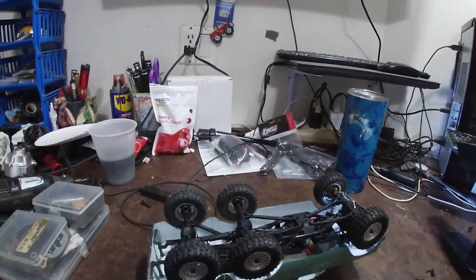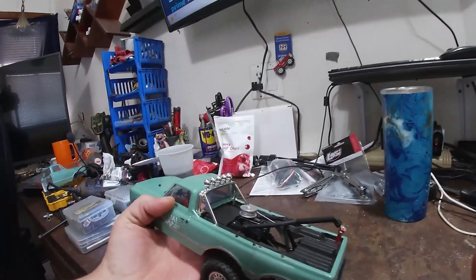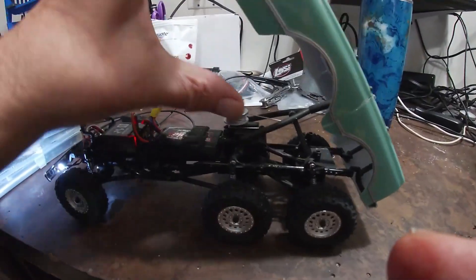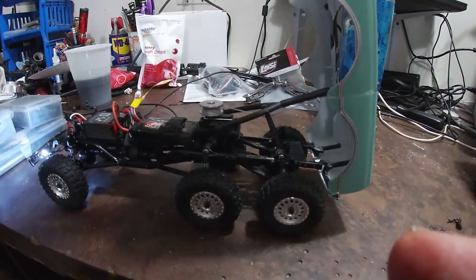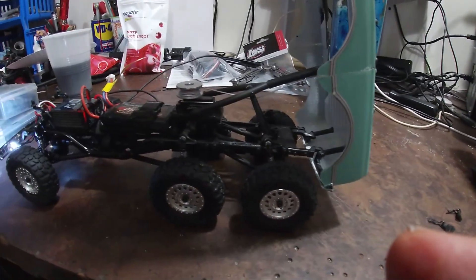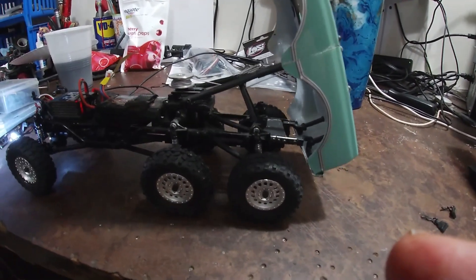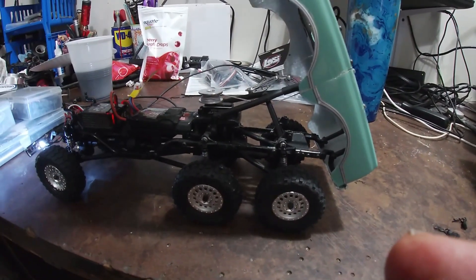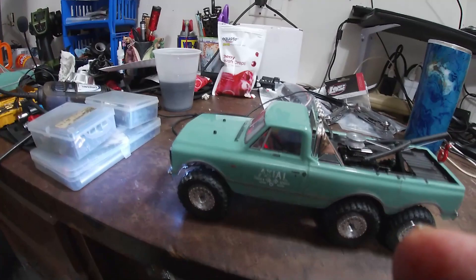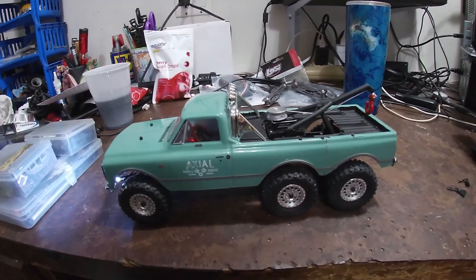That's all I'm going to put in this video — sorry I lost the build footage. The servo mount mounts to the battery tray on the backside and there are two screws that hold it on each side, going through the shock tower. It does have some aluminum shocks; these come with two different rate springs and I put the softest ones on because the ones that were on it were way too stiff. I think it turned out pretty good — can't complain. That's all we got for today, thanks for watching, I'll see you next time.